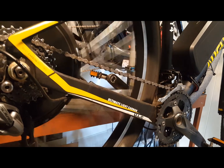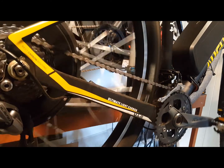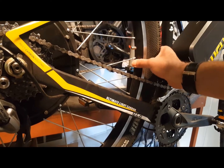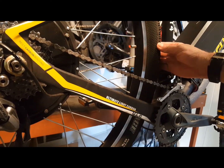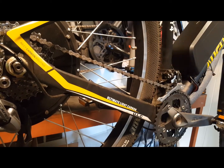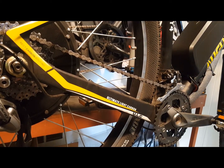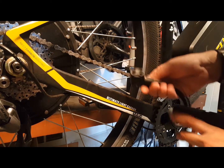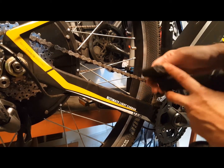An often overlooked maintenance tip on e-bikes is tire pressure. The bike is overall heavier and therefore is absorbing more pressure on each ride. It makes it even more important to constantly check by touch whether your tires are inflated. Get a good pump that you can work with both Presta and Schrader valves. Those are the two standard valves used in inner tubes.